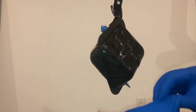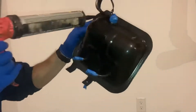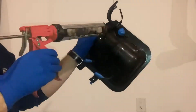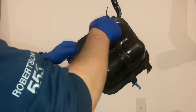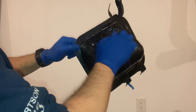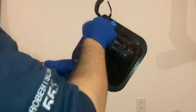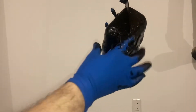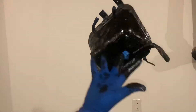Let me stress — you want good thick gloves for this next step. If you use cheap gloves and they rip, you're going to end up with this goop all over your hands and it does not come off easily. Use the tip of your caulking gun to get into any deep crevices and just start squirting all over the flats. Try to keep your caulking gun hand free from touching any sticky part of the tank. Now we're going to spread this like finger paint — you'll find that this stuff spreads like peanut butter at minus 40, it's really thick. Make sure you concentrate on any areas where there are joins between two pieces; we really want to prevent moisture from getting into these spots. Make sure you get an even coating over the entire surface but don't worry, you can always touch up missed spots later. Good gloves — nothing on my hand.